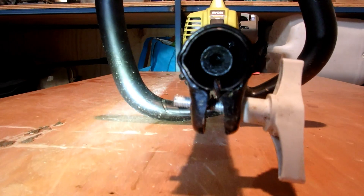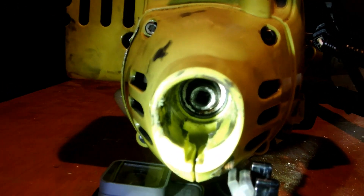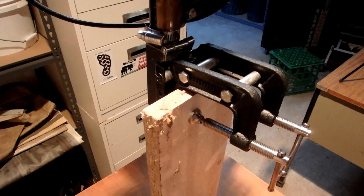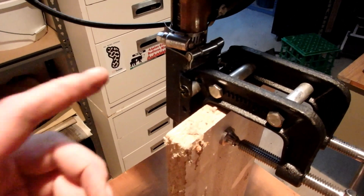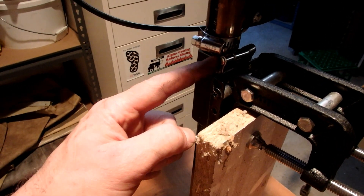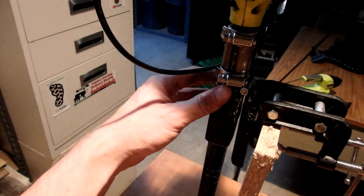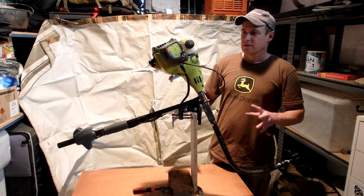The shaft locator in the middle matches the shaft locator in the engine, so you can simply remove the middle shaft and insert the implement into the engine. The transom mounting clamp I made out of a couple of 50mm G-clamps that I've bolted together and screwed a plate on the back of. That plate has a flap hinge bolted onto it, and the flap hinge is welded onto a piece of tube which allows the prop shaft to spin.